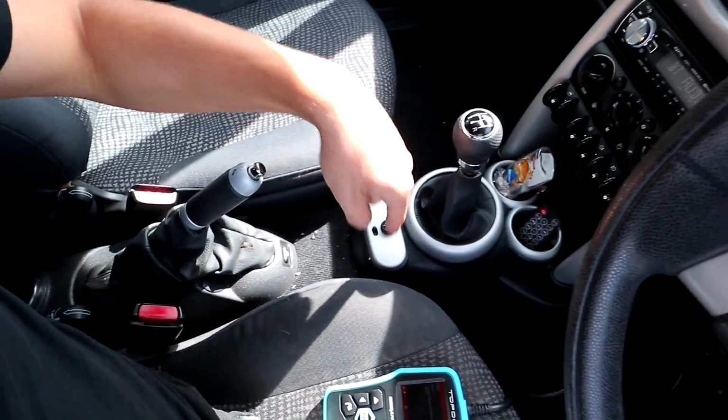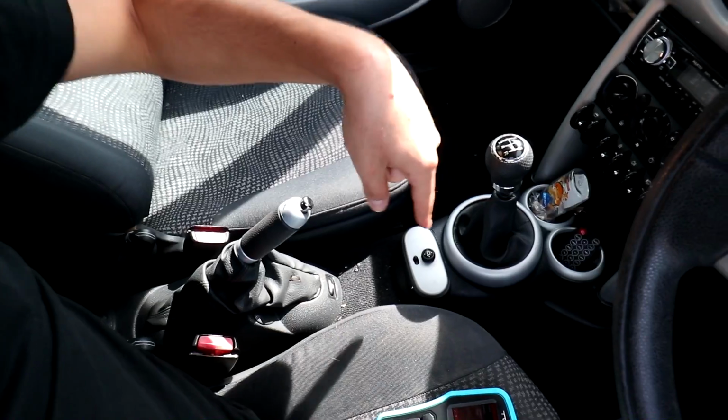We're going to change the catalytic converter, which goes from the exhaust manifold to sort of around this part of the exhaust just under the car here. It's quite a small piece of the exhaust, but it's also got the 2 sensors in it as well, which you need to swap over from the old one to the new one. That's enough talking. I'm going to quickly show you the live data just so it's on record and you can see it for yourselves, and then we'll get to work and we'll get this exhaust or catalytic converter changed out on the Mini.